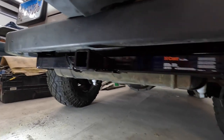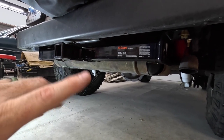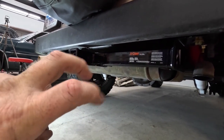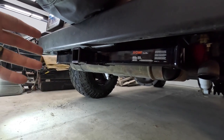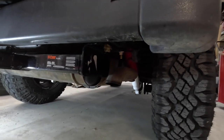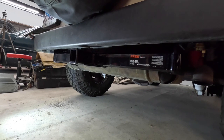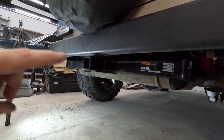I've mentioned in a couple of videos that I planned on putting a trailer hitch on here. These Jeeps only have a 2,000-pound towing rating and I believe the hitch is rated at 500 pounds of tongue weight. I have no intentions of towing with this — it might see a utility trailer with a lawn tractor on it. But the main thing is I have a bike rack so I can put a bike rack in the hitch and carry bikes. Also, the bike rack has a tendency to block tail lights, so I've got a small light on it, kind of like a third brake light type of deal.